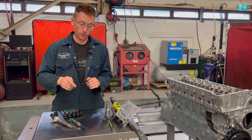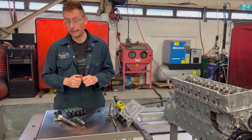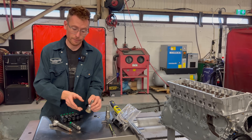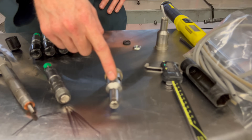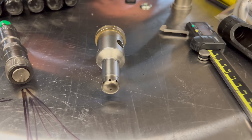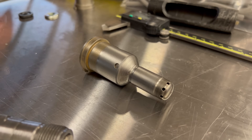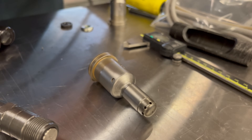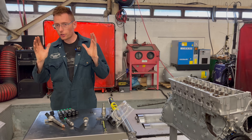The reason we don't use indirect injection pintle style injectors anymore — I'll show you now. This is a pre-combustion chamber. Look how it has a similar pattern, a similar arrangement to those tiny little holes we just saw in the direct injection injector. That's because it's doing a very similar job — diffusing the fuel into the cylinder — but doing it on a much lower pressure scale.